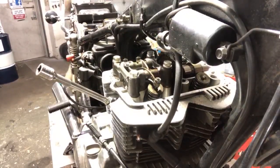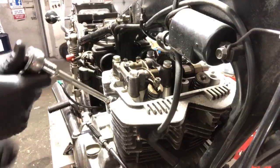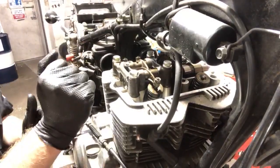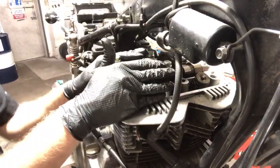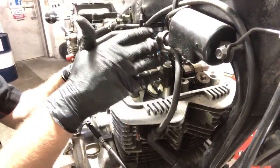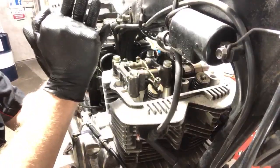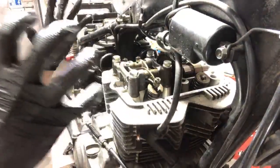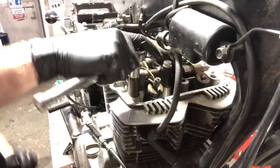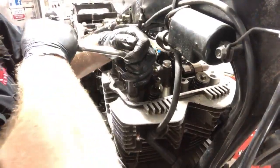There's about four different ways that you can verify if you're actually on the compression stroke. But the compression stroke is key to everything when it comes to timing. You can have it on the exhaust stroke, you're right, but that's not where you make your adjustments or where you time it. You time everything based off of top dead center of the piston, top of its movement at the compression stroke, when all valves are closed. As long as you can harness that knowledge, everything else comes pretty easy unless you're working on like an ST1100 or a...